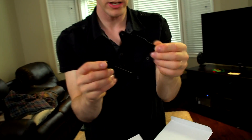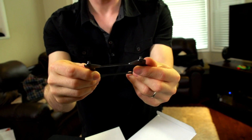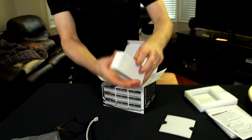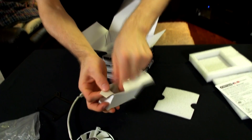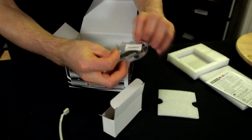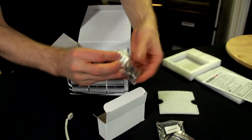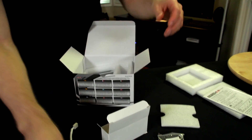Here's a backplate for LGA1155 and 1156 — very sturdy and very thick, which is about what you'd want. There are more packing materials and accessories in a box. So I guess more mounting gear, and here is an accessory for presumably fan mounting. Next are screws for LGA1155 and 1156, and finally screws for LGA2011. Then a nice big thing of included thermal compound — very nice.